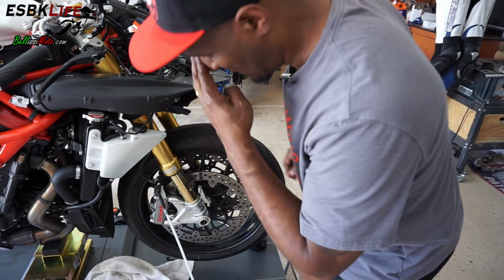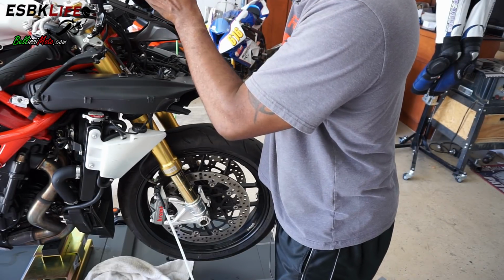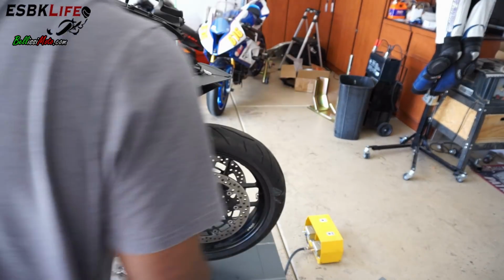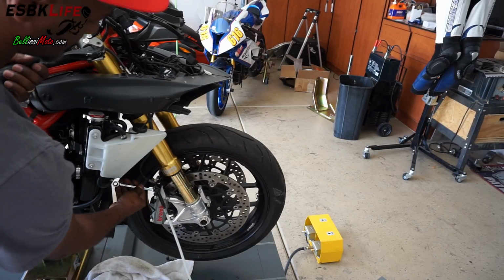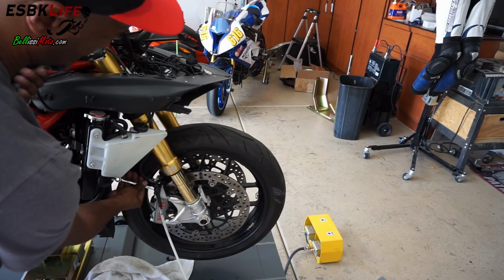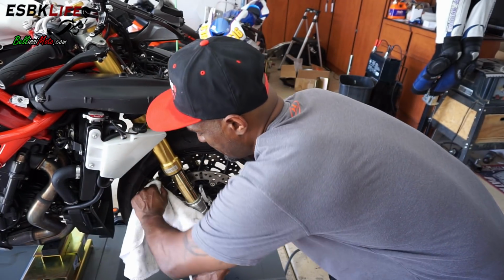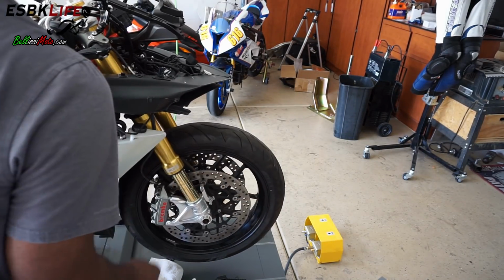All right, so now we are over here on the left side, or the right side, excuse me. And my level is a little low here, so I'm going to top that up. And then we're going to do the same thing. Pump, pump, pump, pump, pump, open, close. Okay, I got good brake feel there. Let's take this off. Clean that up, and let's check. Give the wheel a spin, and it stops.